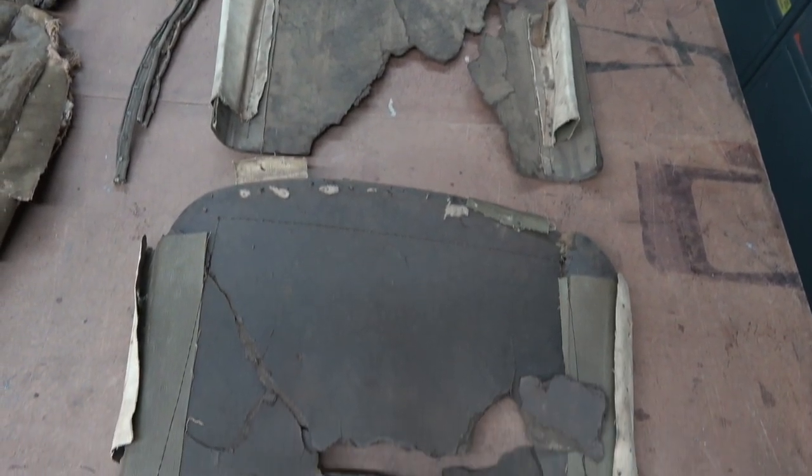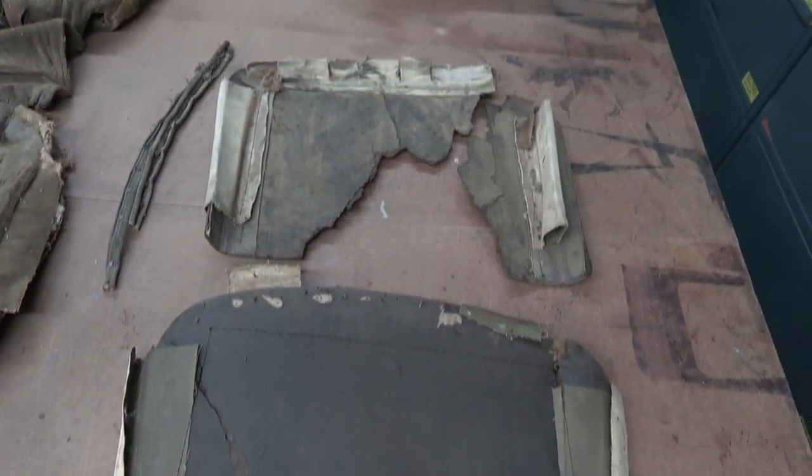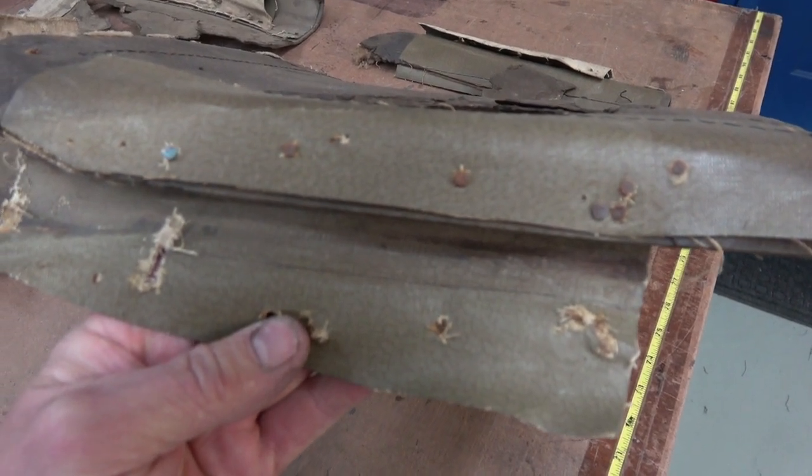Let's talk about this stuff here — this is the foundation underneath our covers. That's kind of where you have to start, aside from having your wood base. This is a shaped panel. Before we get to the covers, you've got to make the foundation. You've got your seat frame and your seat base underneath that, which is made out of wood. This piece is what I need to attach the seat spring for the backrest up to the seat frame, and also to give a nice firm structure on the back side for your padding and material. Looking at this material, it looks like some old original sport coupe top material. I'll bet you what they did is they just used scraps around the plant — whatever they had. This sure looks like top material, and it's tough.